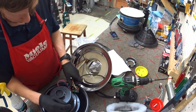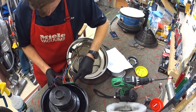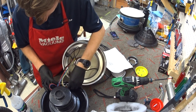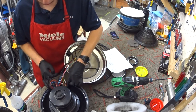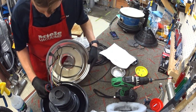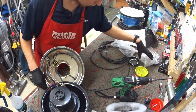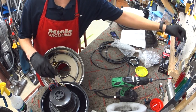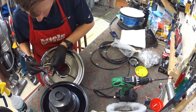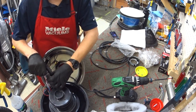Let's put the circuit board back where it lives. Well, it looks like they've had a couple different circuit boards because they got two different mounting parts for the board. It's actually a place here to mount a board and a place here. So that could get confusing when you're putting this back, I suppose. As you know, I always like to put circuit board screws in by hand. They don't ever need to be torqued a whole lot. And I would sure hate to over-torque one and split a board.